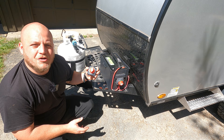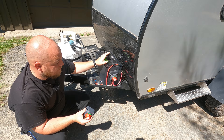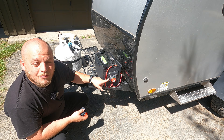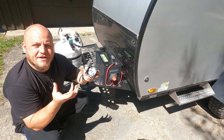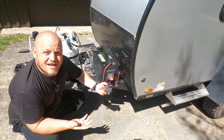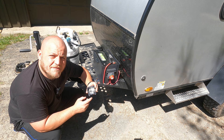Now that the switch is functioning, we want to find a good location to place it. One of my favorite spots is right under the handle. Remove the bottom panel from your switch — you don't want to remove the sides or the top. Even though this is a waterproof switch, the last thing we want is to create a reservoir that fills with water. Don't open the front panel either, because driving in winter means tires can blow water and snow directly at it, which can complete the circuit and break the switch. Keep it so water can drain freely out the bottom.